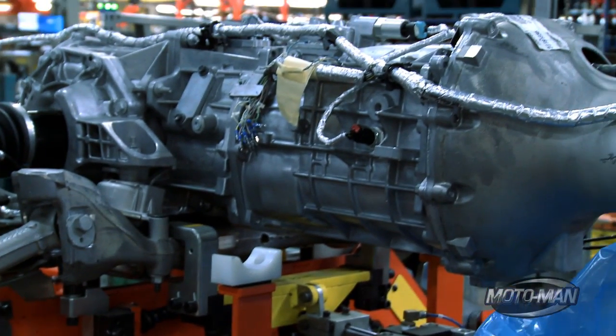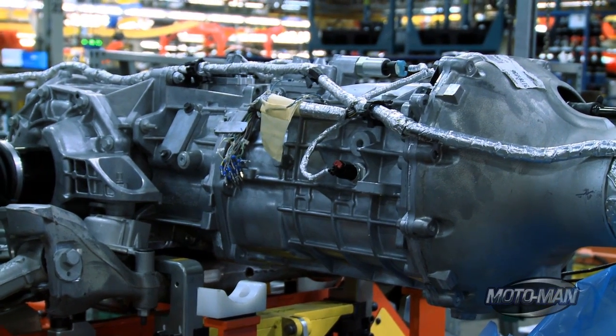25 millimeters thick — so an inch thick in certain locations where the suspension attaches to the body. You want that to be like a bank vault, just dead solid. And the previous car didn't have that nearly as much. We use these hollow castings where you can put internal ribs, so it's a shell of aluminum with internal ribs.